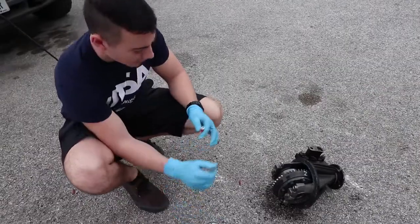Welcome back drifters. Today we're going to show you guys how to weld your Miata's diff. If you've got the 1.6 with the VLSD, this is going to be helpful to you. Basically on those things they have a sealed unit, so it's kind of hard to get the gears when you're trying to weld it. Things are prone to breaking after you do this, so be warned — it's possible you might weld it and then first day on the track go and blow it. But at this point we're doing it because the diff that's in there now is currently blown anyway, so let's just see what happens.